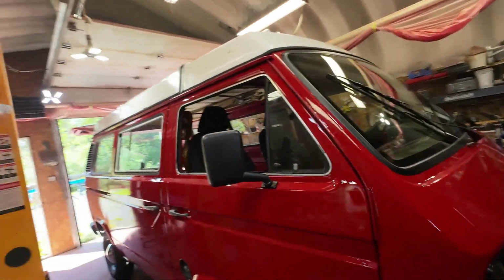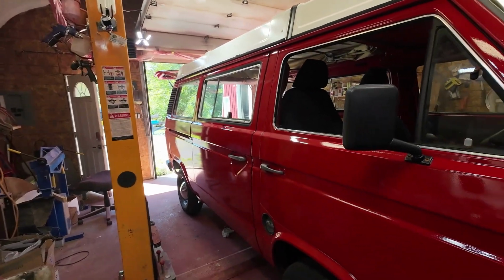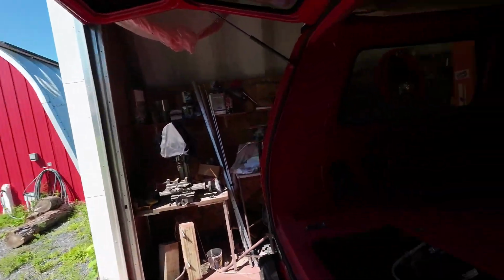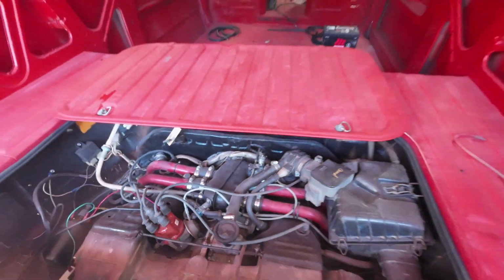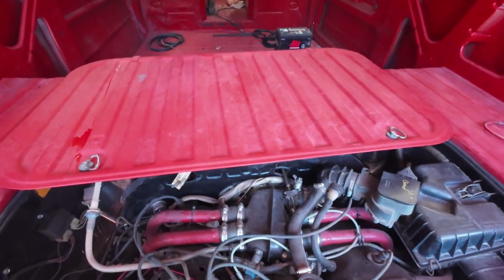There it is, back in. So now, what I did was, I finally figured out how come I couldn't get the idle to work, because the return spring on it isn't as strong, it's not pulling the throttle back all the way. So I'll put a spring on there. Don't know what it needs for a spring.